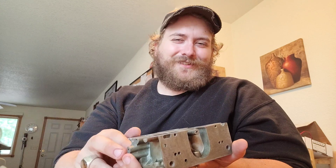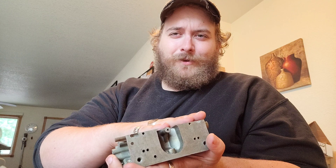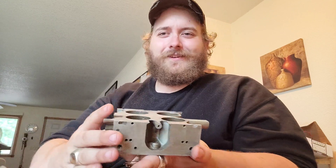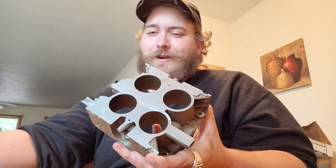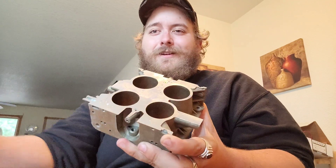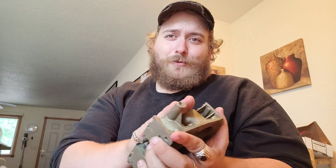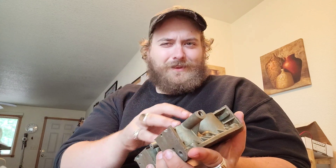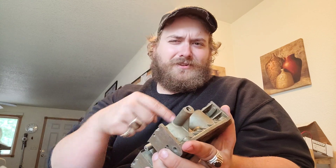What XMC is — as you can see — we have milled the complete top of this carburetor off. Way more than just milling off a choke tower. This is extreme modification. We are making our own top to put on here. We are not going to be limited to any design limitations like the old carburetors are, because they're limited.